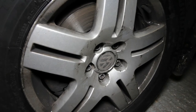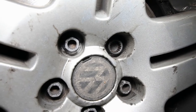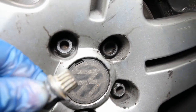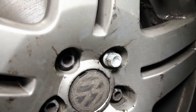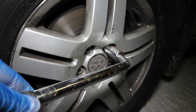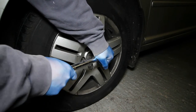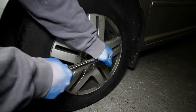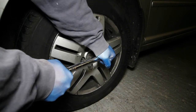Yours may not still have those on there, or yours may not even have alloy wheels, so you may be just going straight onto the bolt. Next thing you need to do is remove the locking wheel nut. We've got this tool — the splines on the bolt fit in there like that. They come in all shapes and sizes, so yours may be a little bit different. Take your wheel brace and place it over the socket like that. Keep one hand there so it's pushed in, and one hand there, because locking wheel nuts do have a tendency to slip or break, so this limits the amount of movement.